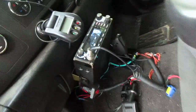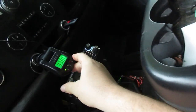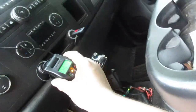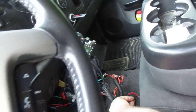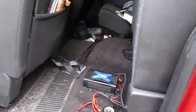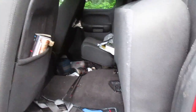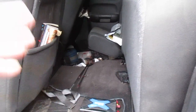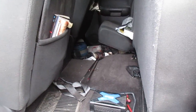I just booted it up and there's my CB. This other charger I usually plug in when I'm parked so I keep an eye on the starting battery, because when you're out camping you're opening and closing doors and you don't want to drop it too low. The low voltage disconnect is really critical — it really helps the battery. You want your load disconnected when the battery drops below about 12 volts, because you don't want to get down to 11.5 or 11 volts and fry the innards of the battery.